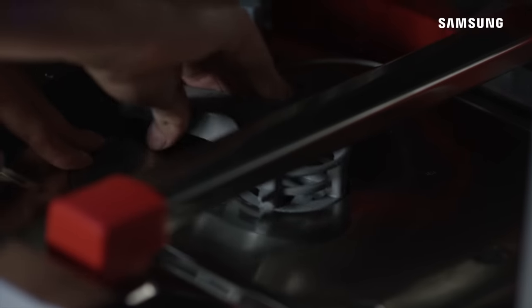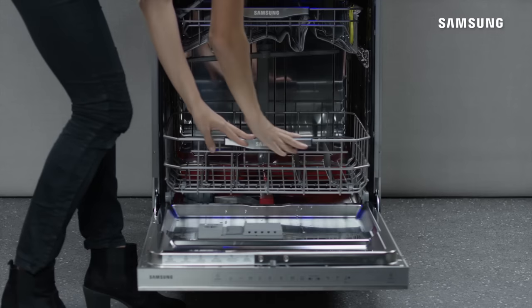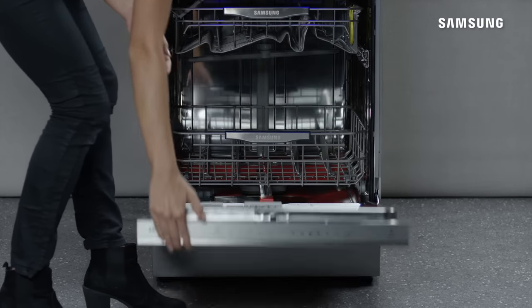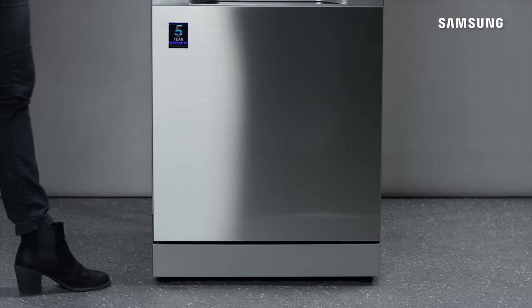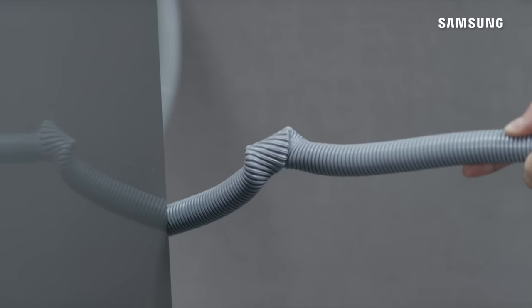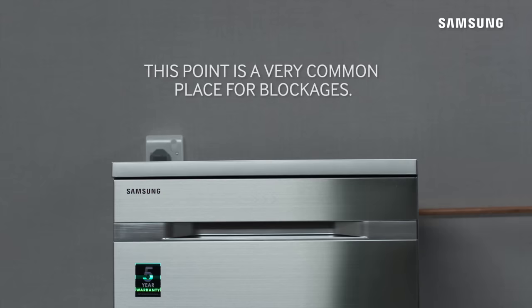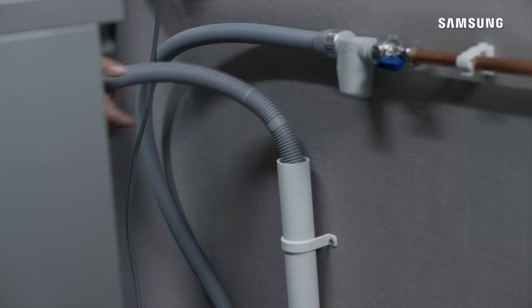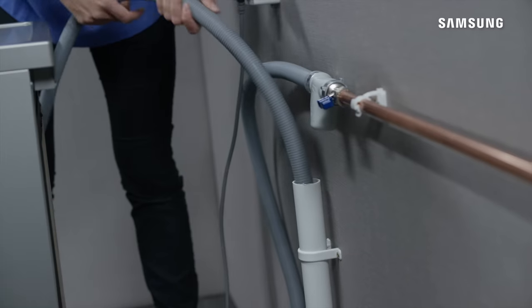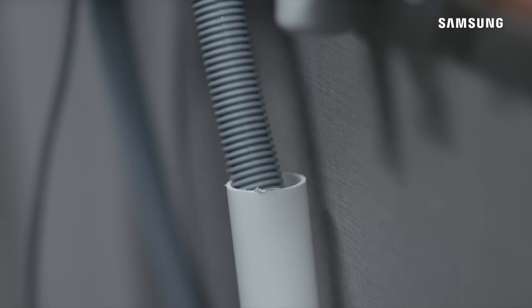Replace both filters and ensure that they are fitted correctly. Ensure the grey handle is locked back into place and the arrows on the handle match the arrow on the filter. If the dishwasher still does not drain, check the drain hose for kinks, and if connected to a sink waste, remove and clean it — this is a very common place for blockages. If the waste hose is connected to a standpipe, ensure the hose is not pushed too far down the standpipe, as this may cause backfilling and contamination of your dishwasher.